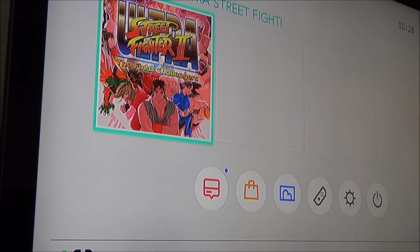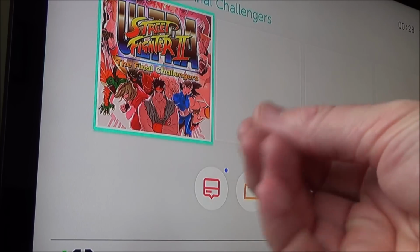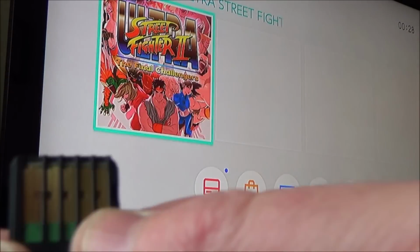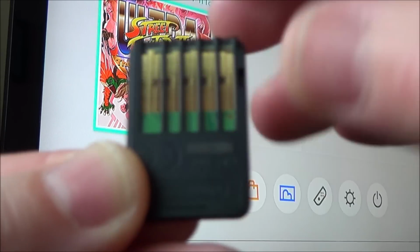Remember, I was poking around in there with the brush. I'm going to basically bring it back over to the blue mat, and I'm just going to have a look closely and see if I can line up those contacts on the inside. Maybe I've knocked one of them slightly out of place, because if you look at the game card, there's actually quite a few contacts here. So if you look at the first one here, you think there's just 3, but it's not, there's 4. So there's 3 different lines, and that one is broken there.